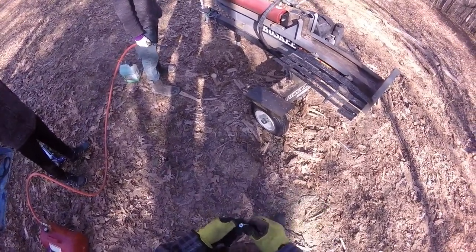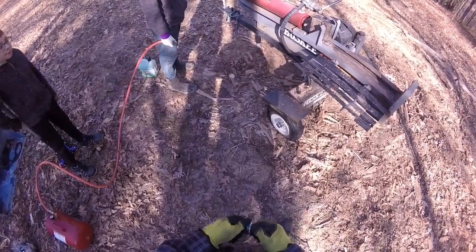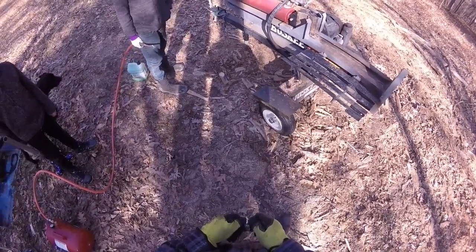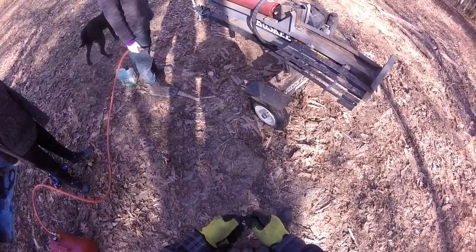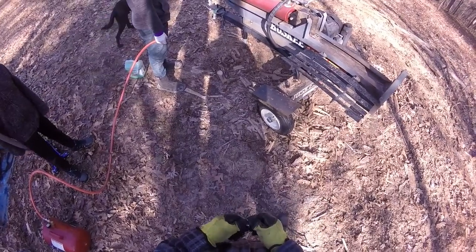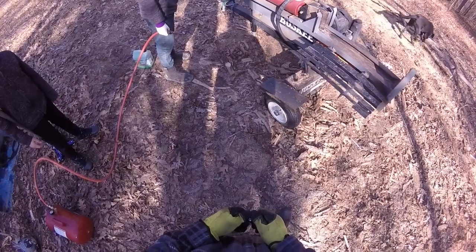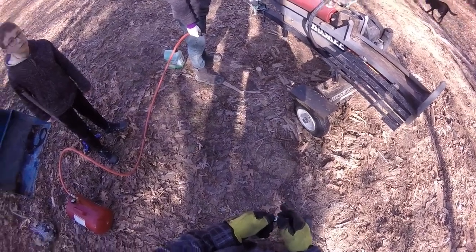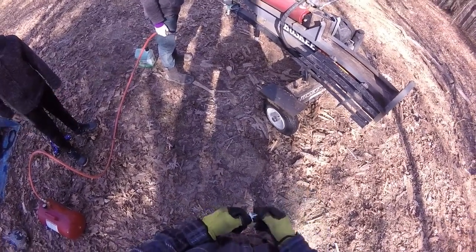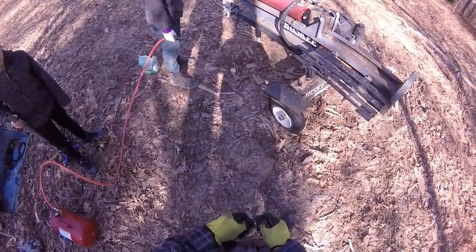Of course, a tube offers some advantages because you don't have the mess inside later on down the road. The disadvantages, you have to have that size of tube handy when you have a leak, and sometimes you don't, so you might have to wait for that. The other disadvantage for tubes, I found out in some cases, is it holds moisture between itself and the rim and can cause the rims to rust out, whereas with the slime, you're not going to have that trouble. And the other thing is tubes can tend to leak over time, whereas the slime will continue to patch holes in operation.